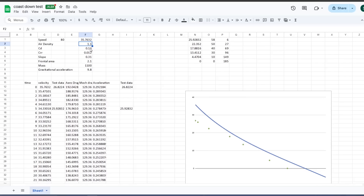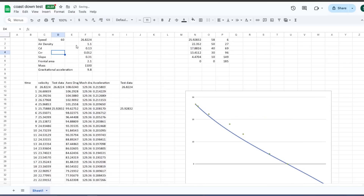However, you can't get reliable numbers from just one video — you have to run this test multiple times, probably around 10 times. Some of the data points from this one video just don't make sense. They start at 60 mph, and you can play around with different coefficient of drag and rolling resistance values. I took the slope off because even with a perfectly flat road, they mentioned in the video they were heading uphill at 0.31 degrees, which would make the coefficient of drag come out as a negative number with the data they provided. The frontal area is about 2.1 meters squared, mass is about 1,100 kilograms, and gravitational acceleration is 9.8 m/s².